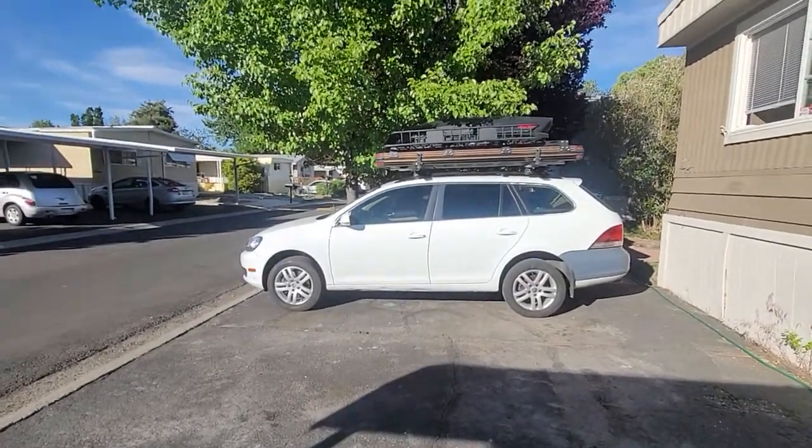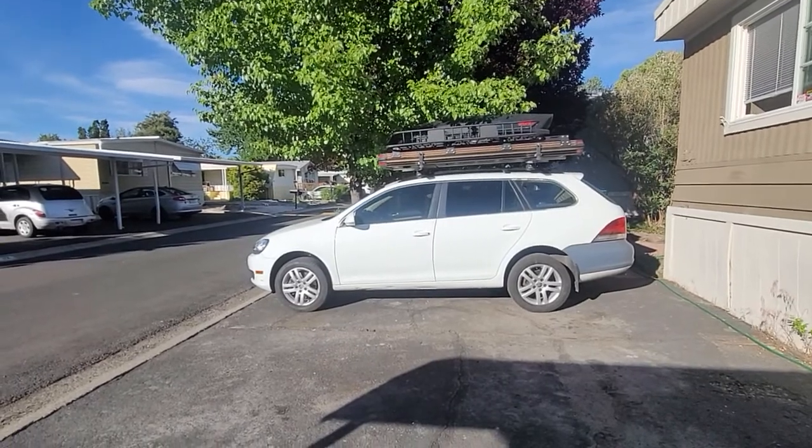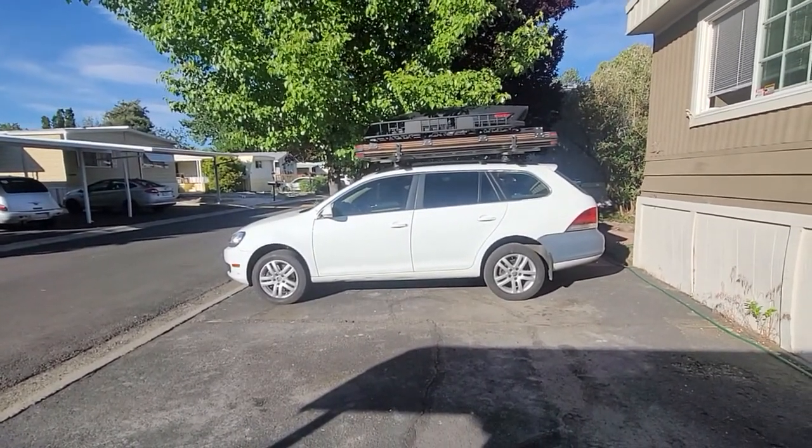Current plan is, I can't put 15-inch wheels on there because the rotors are too big. If I could put 15-inch, maybe I could get some bigger tires. So I have pretty much no choice but to cut the wheel wells. I'm going to try to cut the wheel wells and hopefully get enough space to put the KO2s on there, unless I can find some other multi-ply tires. Where we're going in the desert, it's not going to cut it. These single-ply tires, even though they're great snow tires, great road tires, and smaller tires do get better gas mileage, they're just not going to bear the stones in the desert, which cut like concrete.